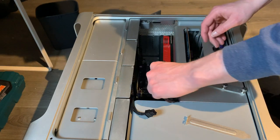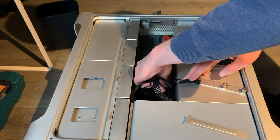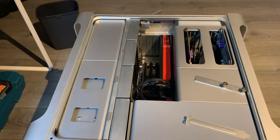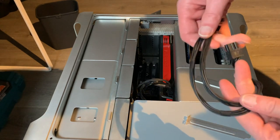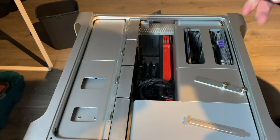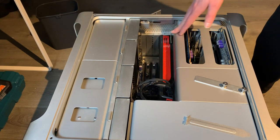It was actually quite a bit tougher than it's supposed to be, but I just needed to realign everything on the second try — we've all been there. Now we need to connect power. I have an extra six-pin here because this is a third-party cable. I do have official cables — the mini six-pin to full PCIe Express six-pin that came with the 5870. These machines have a 900-something watt power supply so they're definitely capable of handling this GPU. So that's the graphics card done.